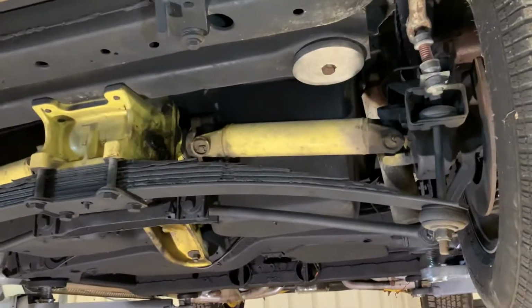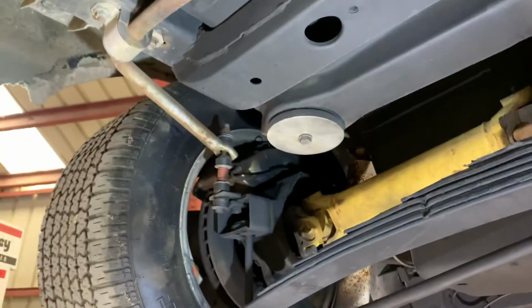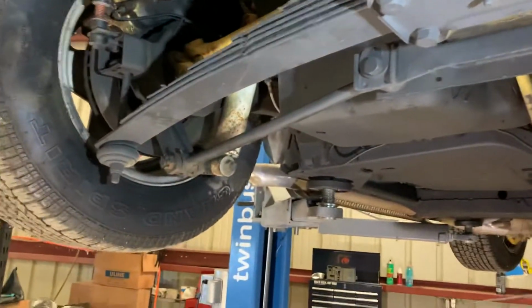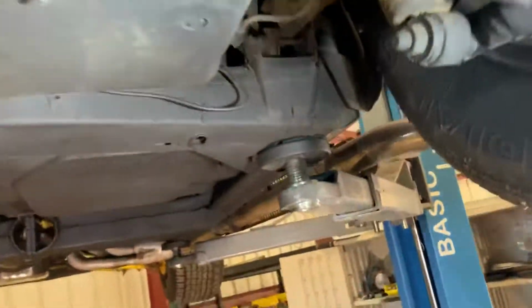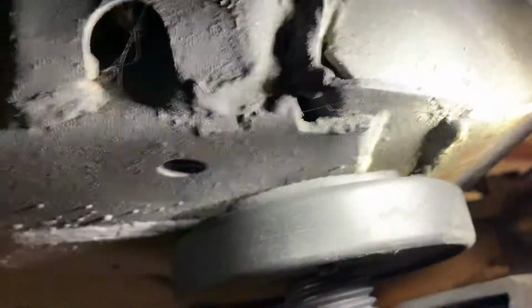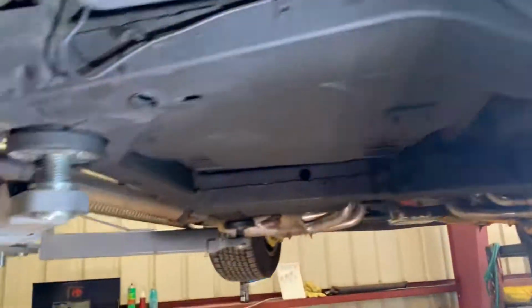Okay, 1965 race car chassis, suspension, super clean California type frame, heavy duty rear sway bar, 7 leaf type F41 spring, heavy duty. Frame super clean, no rust, you can tell right here. That's usually the dead giveaway, otherwise that corner's rotted out. For all you Corvette experts out there, you already know this.